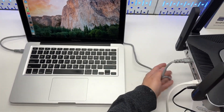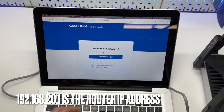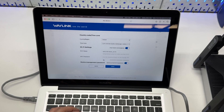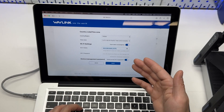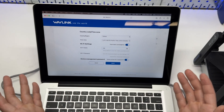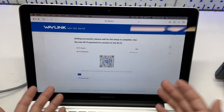Or you can do it wirelessly using your phone, but I find using a computer screen a bit easier. Open up the browser and type in the IP address of the device. It automatically detects the internet connection. Use the default setting and click next. Set the time zone. You can keep the Wi-Fi name the same as your previous router to avoid reconnecting all your devices — that will save you a lot of time. Use the same password and it's done. It's restarting.